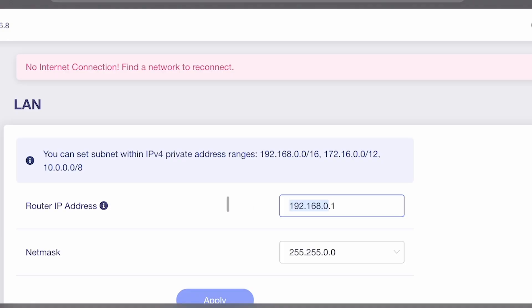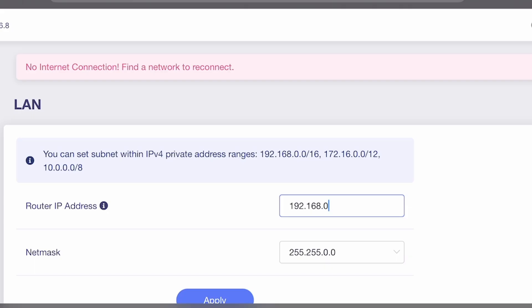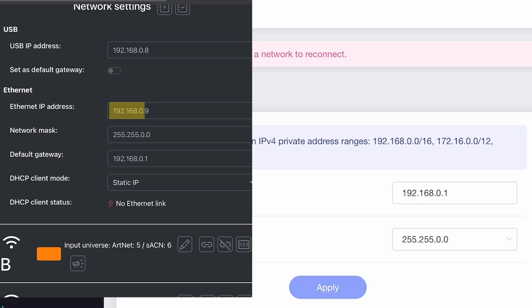Routers typically will always have an IP address that ends in .1, so here I'm using 192.168.0.1. When I first got into networking, all those numbers were really scary, but then you start to realize it's the same numbers over and over. There are other IP schemes and this goes a lot deeper, but I just want to give you a brief overview. If the first three numbers don't match what your Cerise has, you have to change that — if your router shipped with a different IP, change it so it's in range of your Cerise.